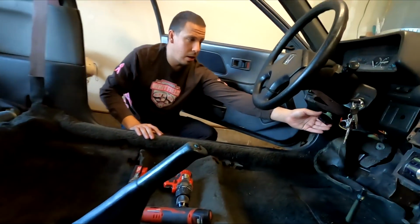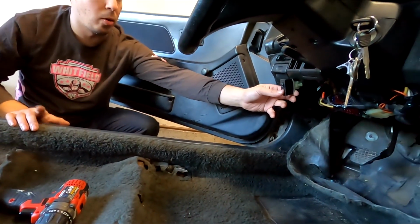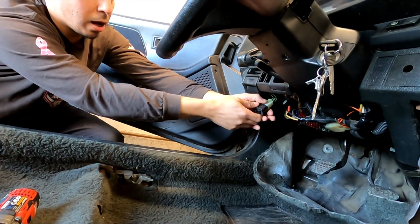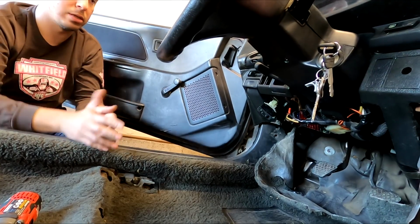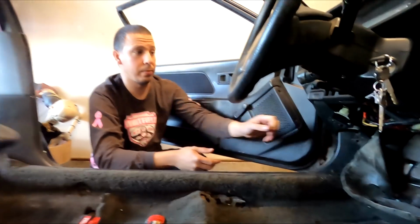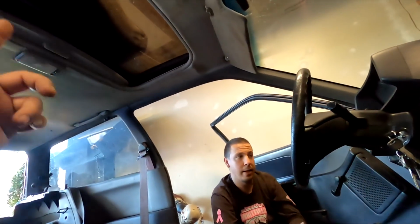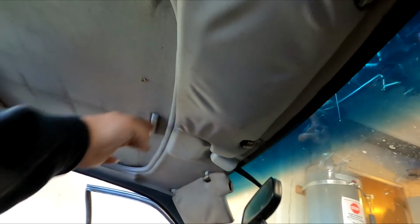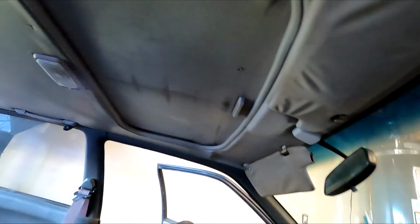I actually had my old switch from my old car, right? And the original switch that came with this car didn't work, and I ended up popping it off and I cleaned the friction out. It was good contact. A lot of dirt and stuff always gets kicked in there. Pretty much sanded it down, and plugged it back in. And it was solid. So no fuse, no motor, or nothing. Just plugged it up, and yeah, it's good to go. Yeah, well, you look at that, nice and not cracked. Yep. This is working. Hell yeah, brother. This right here is what makes it an SI.